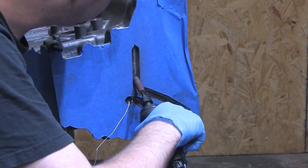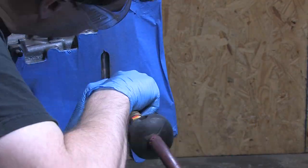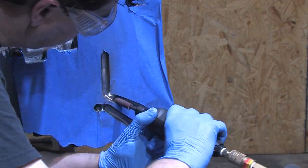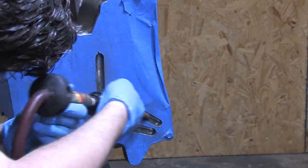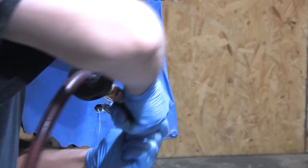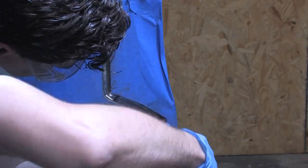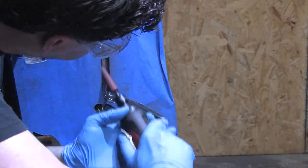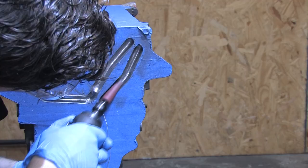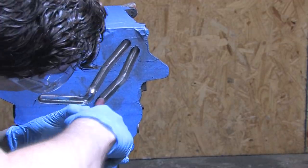I start off with a cylinder-shaped roll because they have harder edges and a larger radius at the tip. This makes them a little bit more aggressive than the tapered rolls for shaping things, but because of their hardness and larger radius they don't reach into corners very well. That's when you switch to the tapered rolls. They have a finer tip, and because they're thinner they're also softer. You can aggressively smooth the radiused corners of the galleries and the transitions inside the block with the tip of this, and with the tapered edge contour the areas around the number one gallery hump while putting an even smoother finish on it.